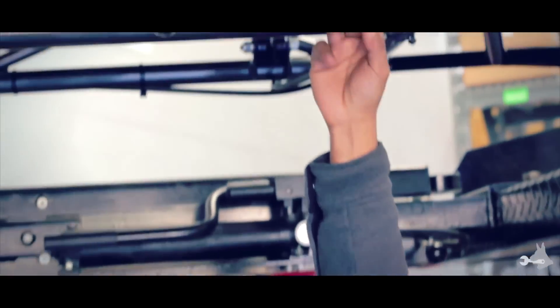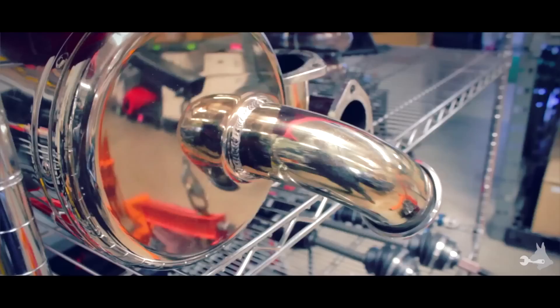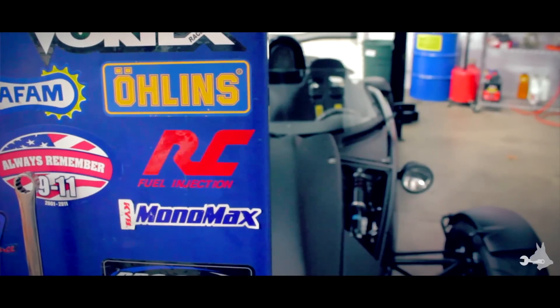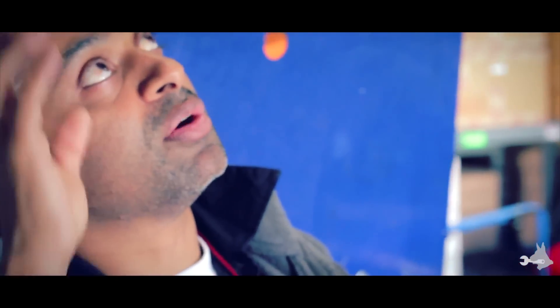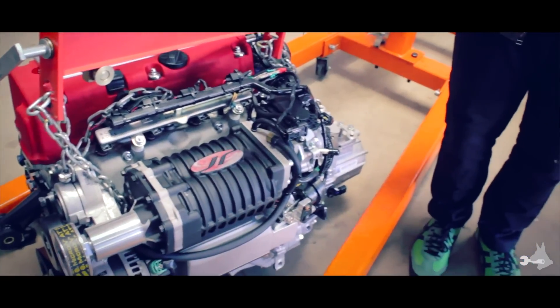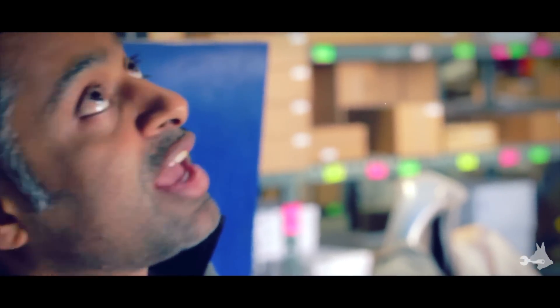The gas tank is located right here, trapezoidal in shape. You can take a peek in here and see we've got a completely empty engine compartment — they come in without the engine, transmission, and ECU, but you do get a muffler and suspension. Since the Atom is a rolling chassis, you can literally push this car around; everything is attached, so you can move it quite conveniently even without an engine. This is different from typical formula cars where the powertrain is a stressed member and the rear suspension actually hangs off of it.